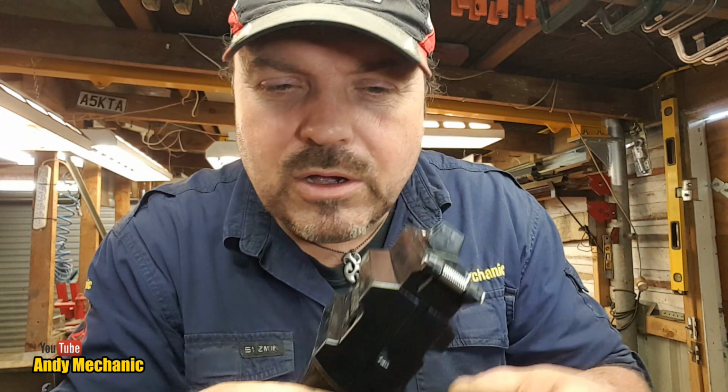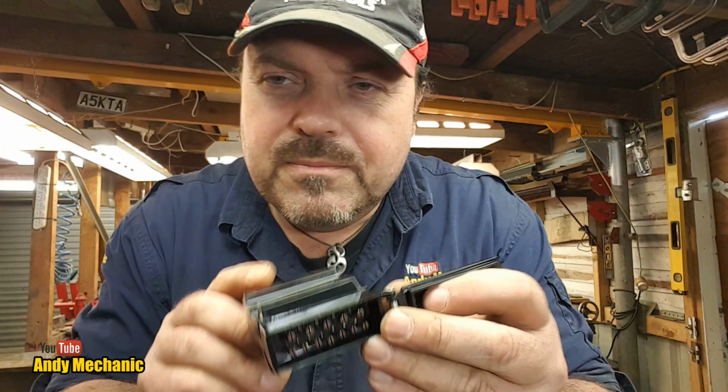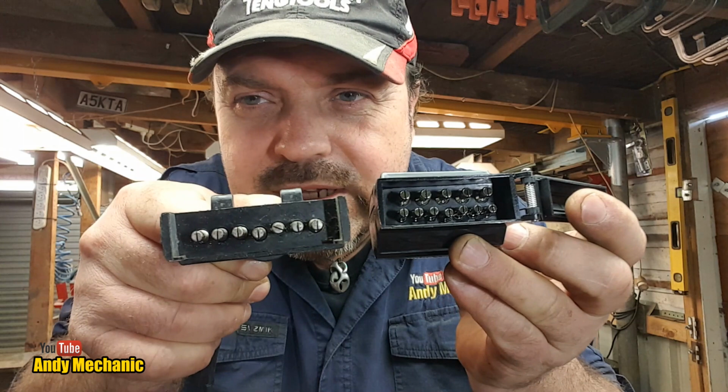I thought, well, if this doesn't fit, we've got a serious problem. I thought, well, maybe it's a Ford thing, you know. Anyway, that's the orientation. So you've got the five large terminals, the high current terminals for running fridges and charging batteries and stuff. And then down below, I think it's seven of the smaller ones, which match completely what we've got on the standard plug.